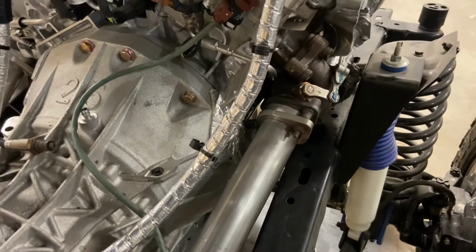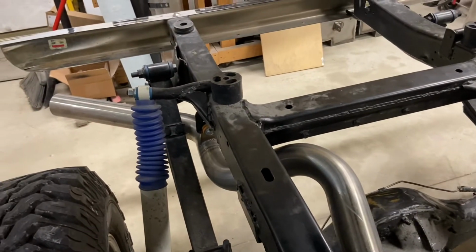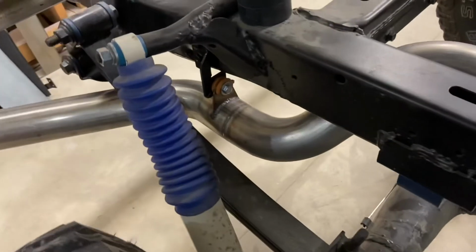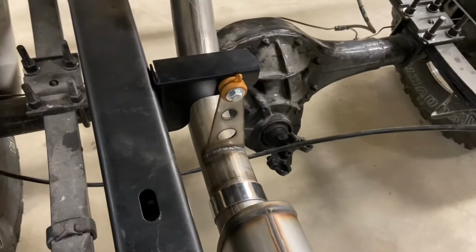So directly attached to the turbos via the 2-bolt flanges, we run a 2.5 inch back to the muffler, and then a 3-inch out of the muffler, and then the tailpipe coming out the side on the passenger side. And then we've got two supports, one in the back in the standard location, and then one right behind the muffler in the standard location.